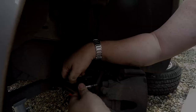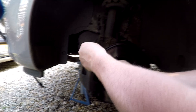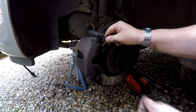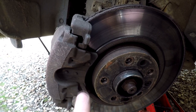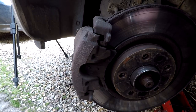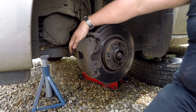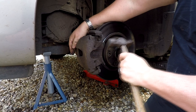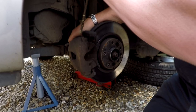These are the two 7mm bolts I've just taken out. At the front here we've got this little spring, so I'm going to leave that out carefully - you don't want this to ping out at you in the face. Just make a note of the way it goes on: the long bit goes behind the back there and comes around and pins into these little alcoves. One of the things we're going to do is clean this caliper right up, because all this brake dust can cause squealing, which we've had squealing problems with these brakes anyway.